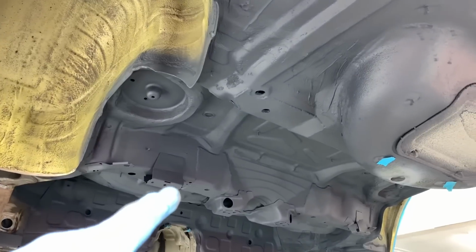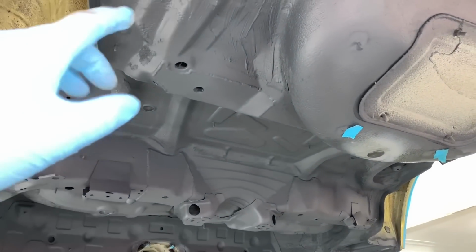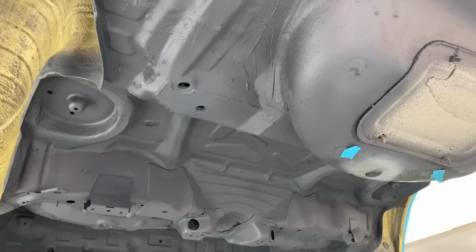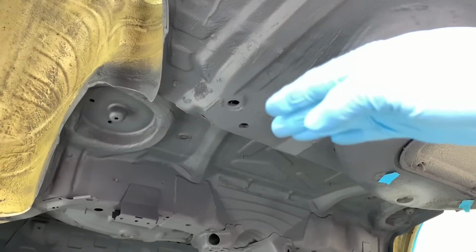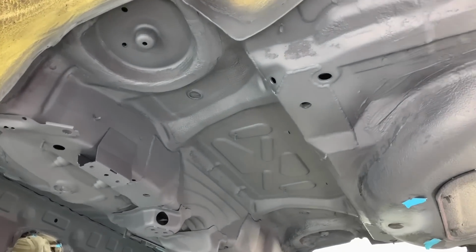So RACP work is done as well. Cracks were repaired, reinforced with the Redish V3. Nowadays it's always standard to do the V3 load relief system, the plates that come inside our kit which connect the back of the RACP through the boot floor to the chassis legs. It closes a hollow channel where they used to flex and pull, and that now means that the RACP isn't likely to move any further.